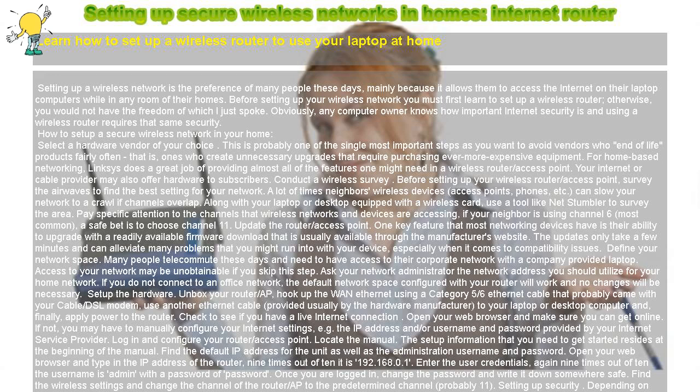Setting up security. Depending on your operating system, you may have the option to be selective on the level of wireless security that you choose. There are 3 generally used wireless encryption protocols that are used in home networking: WEP, WPA, and WPA2. If you can, keep away from WEP as it can easily be cracked using freely available software. However, if you have to use WEP, do so. Some security is better than none. Try to use at least WPA or WPA2, preferred.